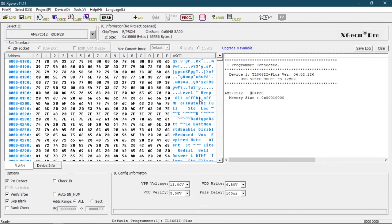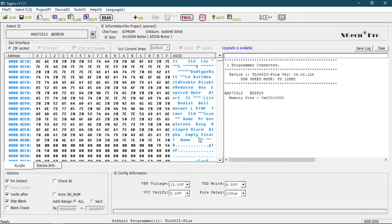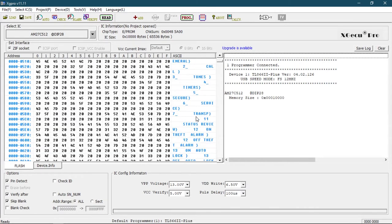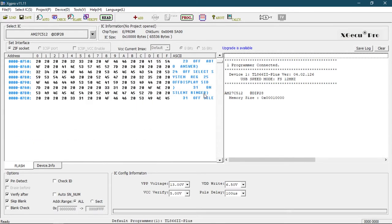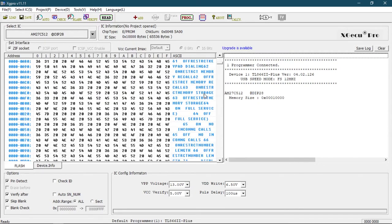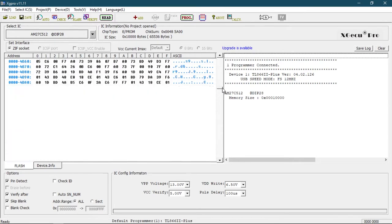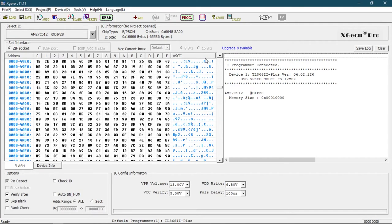Level beep, alt off off, auto full, bad type, battery low... there's a bunch of strings in this. It's got the menu inside it - all the text in the menu. There's a bunch of data and then there's some more. Those strings look a bit suspicious. Right, so clearly this is the EPROM of the phone - it contains all its firmware and everything.